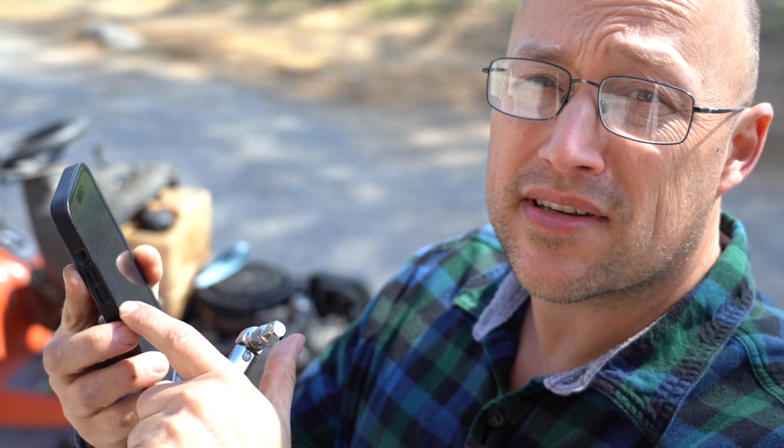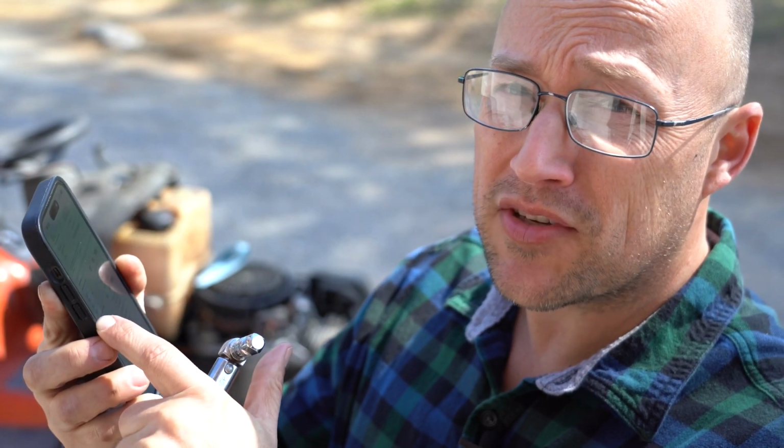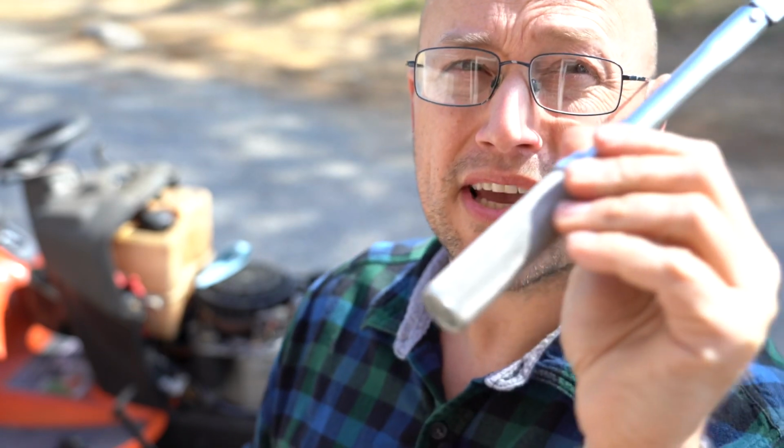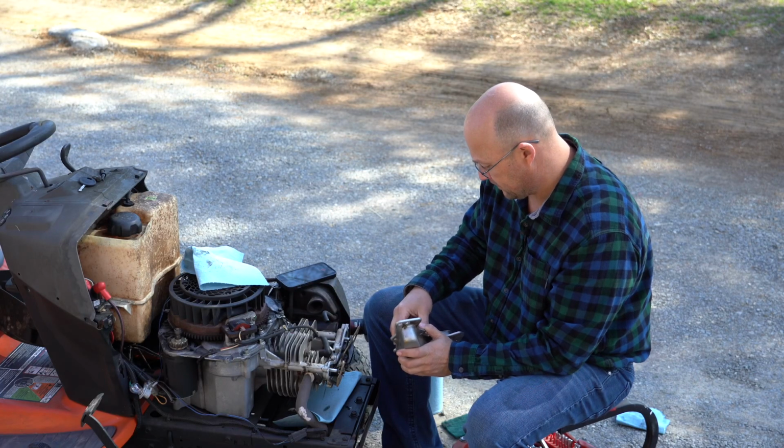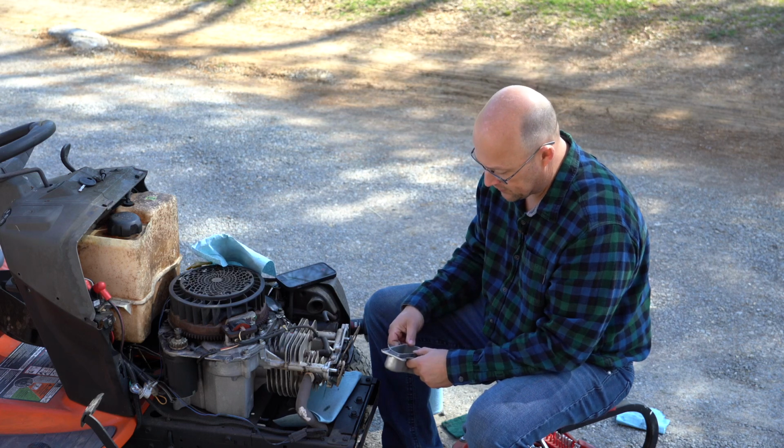So it's kind of important, since we're using a cork seal, that it's torqued to the right spec or you're going to crush the cork. So I'm going to set my wrench to 65 inch-pounds and pray that nothing strips out. Go ahead and lock her in, take that 10 millimeter, and we're going to go ahead and torque this down.